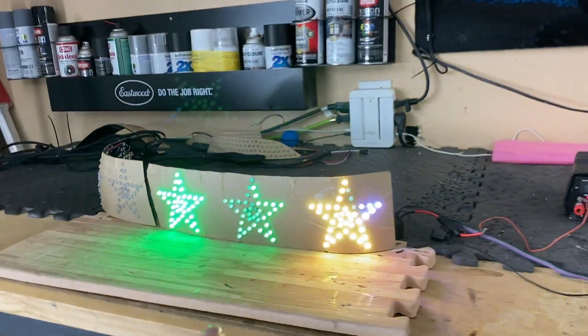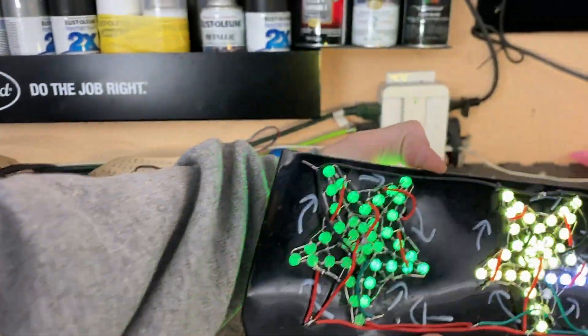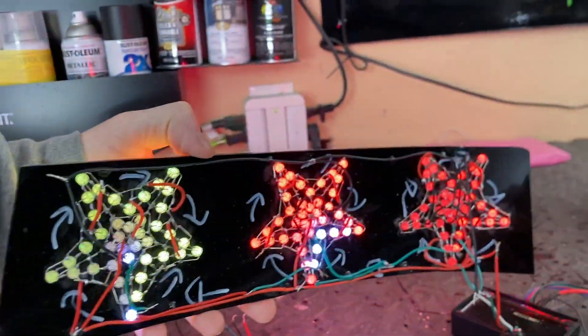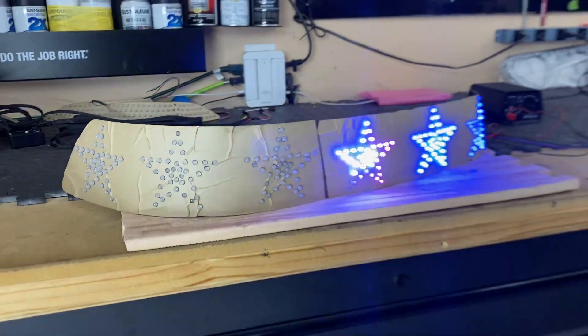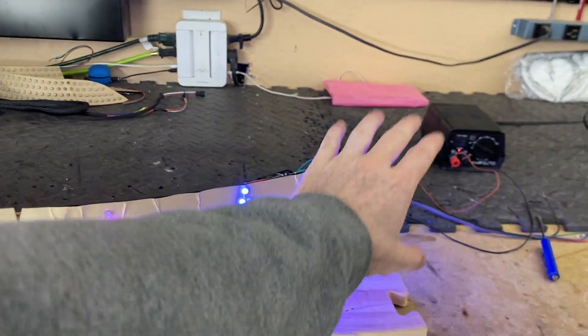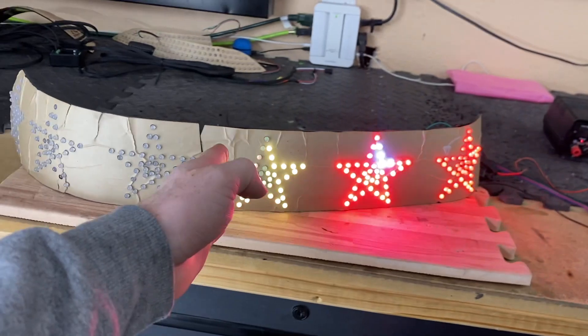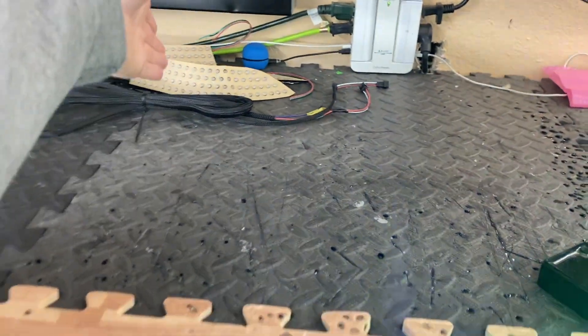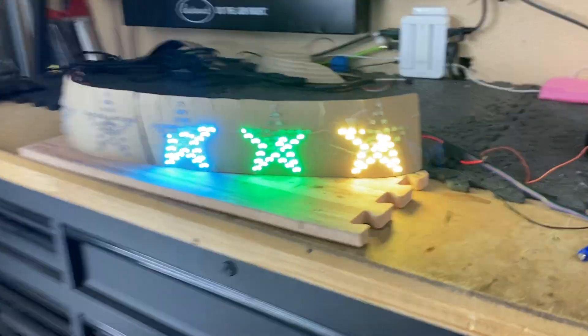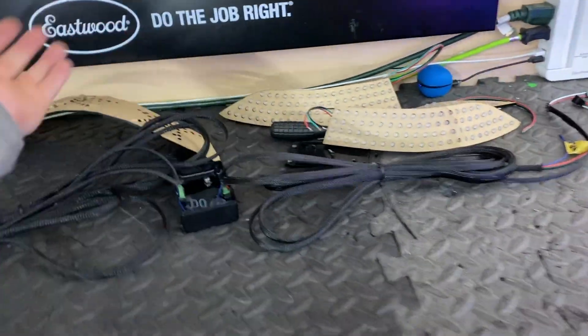I got this one working 100% after quite a bit of wire cleanup. After flipping a couple of the pins around, it works really well now. With both boards sitting side by side you can really start to get a sense of how this is going to flow through the taillight. Unfortunately it's a two-piece taillight, which I really don't like building. We have to have wires coming in to power this side, and wires going out all the way around the trunk, into the body of the car, into the other taillight. It's a big pain to build out that harness.